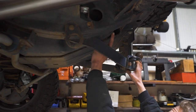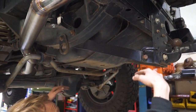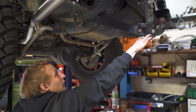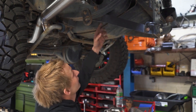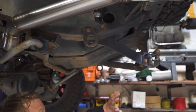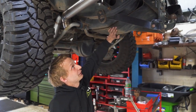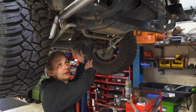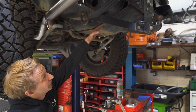If we were to have made that fuel tank absolutely square like a box, it would sit here like this, which means that in a scenario where approach and departure angle is essential, we'd be hitting the tank first before we hit the tow bar. Obviously the tow bar is very substantial and can take a beating, whereas the fuel tank can't. So that one's designed to sit just above the chassis. Even if you were to go up a hill with rocks underneath it, the chances of hitting the tank are much slimmer because there's much more substantial stuff in the way first - the chassis, the tow bar, anti-roll bar, axle - before anything gets anywhere near the tank. That is why it's that particular shape and not square.